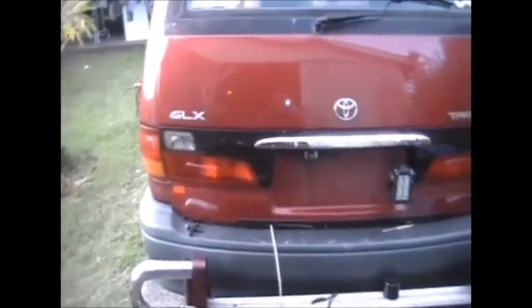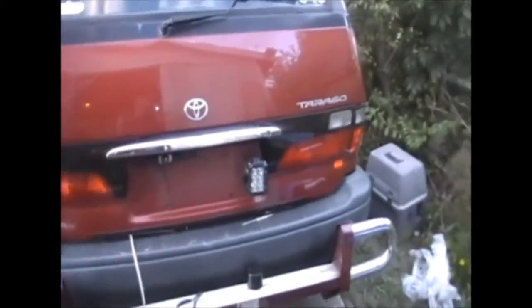Alright, another problem that I had was that pin there I spoke about earlier, and how to unflatten that. It was still a problem. The pin gets bigger towards the end there. Let's zoom in there. That was too thick to go through the original hole. So I've had to drill the hole out, put it on, and now look at that, beautiful. So now I can bolt it down and get to the other side. We're starting to look pretty good now. I've had to do the same to the left hand side as what I did to the right hand side, so there's enough footage on that, I think. And I've still got to change that indicator there. Look how ugly that is compared to that.